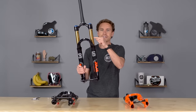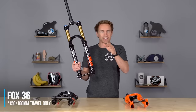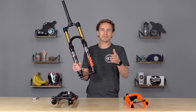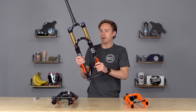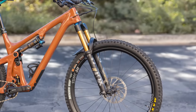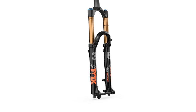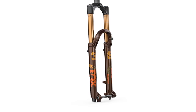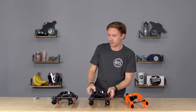The 36 — 36 millimeter stanchion. There's definitely a bit of a blurring of lines between the 36 and the 38. The 38 was new for 2020, which is why we remade this video to introduce it. But the 36 is offered in 140 to 160mm travel, and the 38 in 160 to 180. So just a little less travel. You could call this your enduro fork. I like to call the 38 a super enduro fork — I kind of just made that up; I don't know if it's going to catch on.